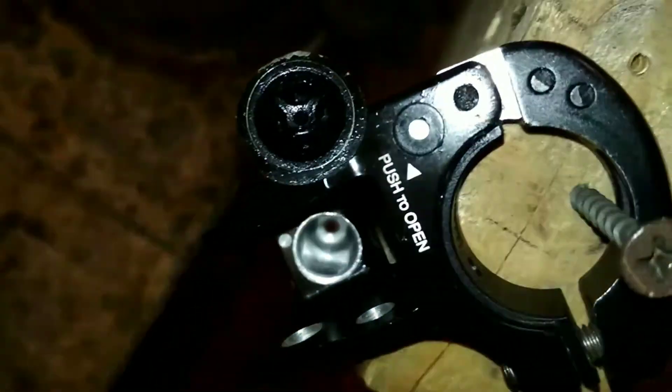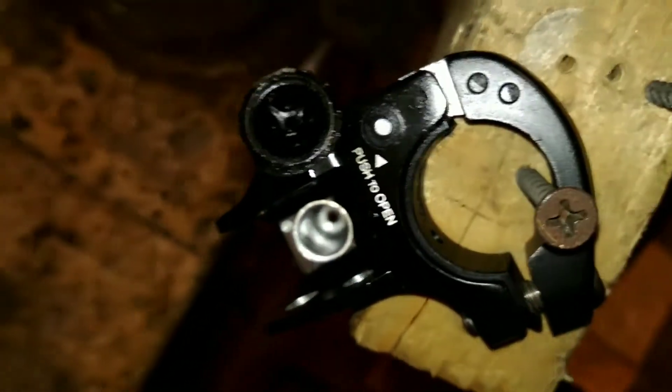If you're getting leaks from behind, from the blade side, that probably means you can try to polish the cylinder with some wet sandpaper, or you just give up and replace your lever, because otherwise there's probably no hope. Let's have a look — I'm not sure whether you will see it or not, but we will try to do the best job possible.